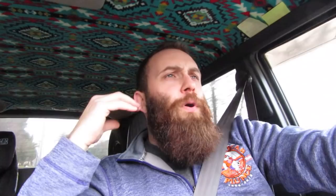As far as the health of the engine goes, there are a bunch of factors inside your engine which will also affect your vacuum. Vacuum is decided by how open the butterfly valve is, but if you have something like a stuck valve, slow timing — be it valve timing or ignition timing — a clogged exhaust creating excessive back pressure, or a blown head gasket, all of those will cause you to have less vacuum. You can actually determine each of these conditions by what the vacuum gauge is doing.